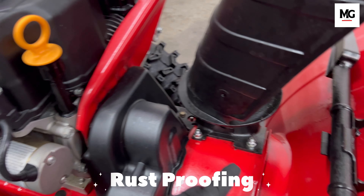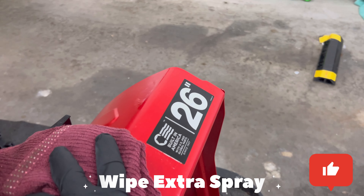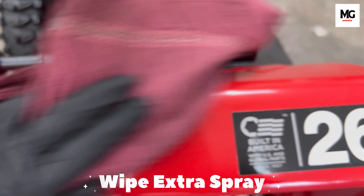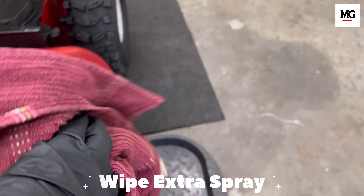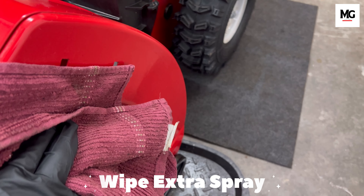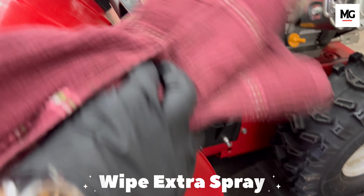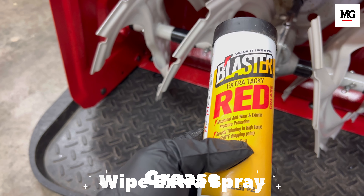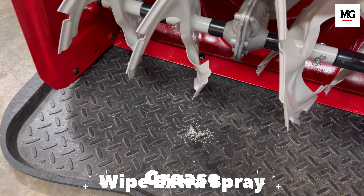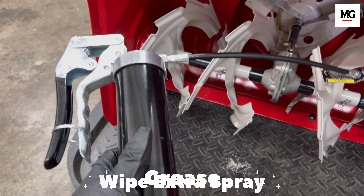You never know when these belts will go while you are out there snowblowing your driveway. Over time belts break — they take a lot of strain from heavy loads of snow, and if it's been a number of years since you've swapped out your belts, or never touched them at all, your days are numbered. You can search the model number of your snowblower online to find the belts pretty fast. Get one drive belt and at least one auger belt, and keep them in a safe place so you always have them for a snowy day.